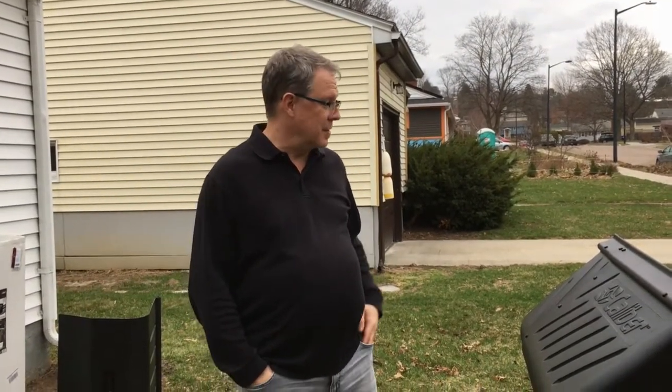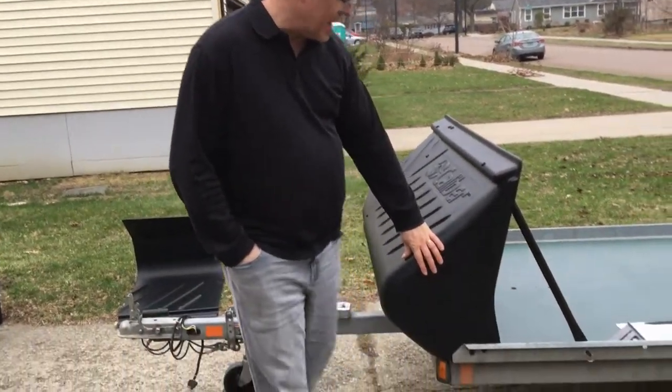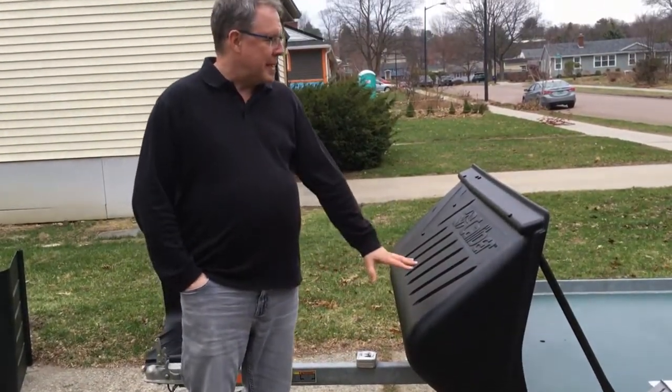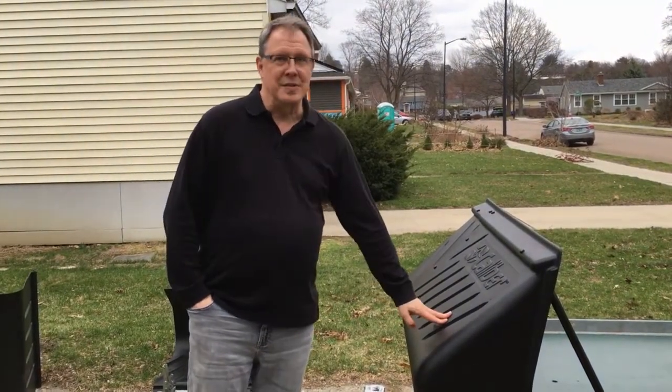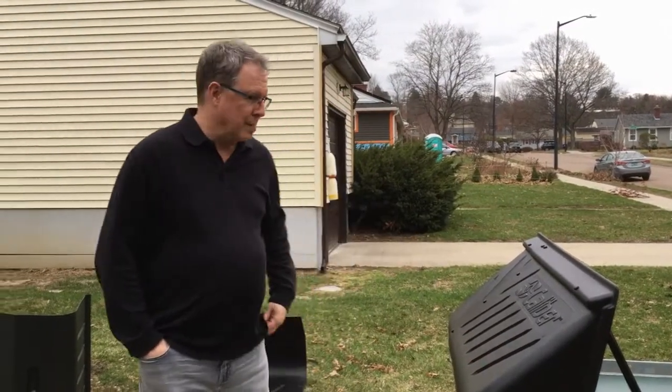The poly shield does not require good metalworking or carpentry skills. It comes with a nice clean finished edge that's not going to catch on your snow pants or jacket when you're loading your sled. It doesn't require painting, it's easy to clean off, and importantly, it doesn't show dents — so rocks or bumps won't show up. The drawback is you need to modify it a little bit to fit your trailer.